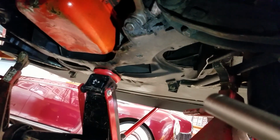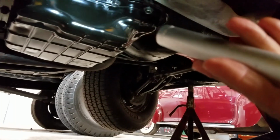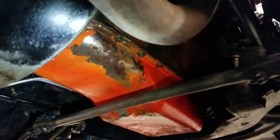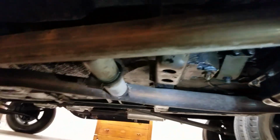It's a little bit beat up from some jacking up going on. A little bit of a power steering leak there, and a little bit of a trans fluid drip here on the floor. That pan's been changed. We can see a little bit of seepage there. Could be rear main. And a little bit of dampness up front. Bottom of the oil pan's a little bit beat up, but you'd be beat up too if you were built in '69.